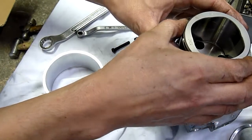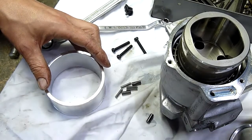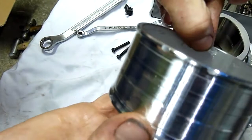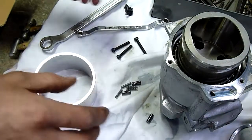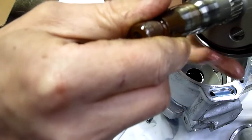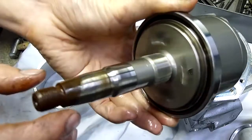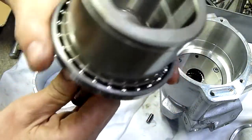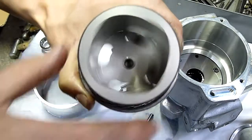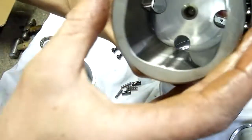You did ask if it was possible to engineer a magnetic inline filter — using steel hydraulic fittings coming off the pump and putting some donut neodymium magnets in it. But the problem is if it's aluminium debris like this stuff here, the magnet's not going to do anything. There's the main body and bearing — this whole bearing would be completely immersed 100% of the time, the whole pump body completely free of air. I can feel grindies in it though — there is debris in it.